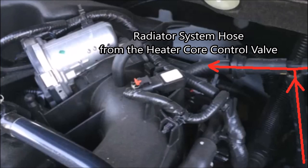This first little hose has to do with the radiator system. With the arrow here, the coolant flows up to the left, but there's also a T-junction and it goes to the right as well. To the left, you have warm coolant coming out of the engine flowing to the bottom side of the throttle body.